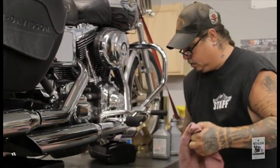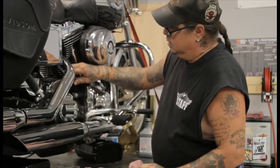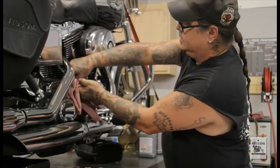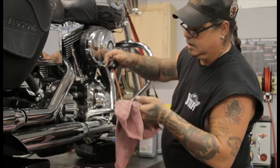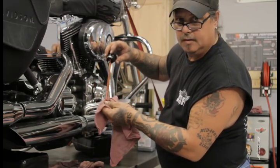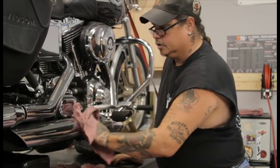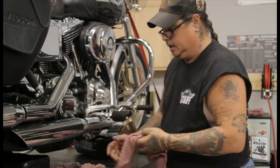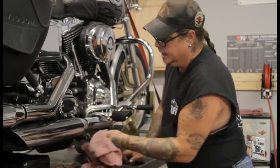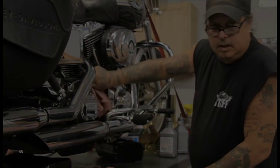Add your last half quart, wipe the dipstick off, reinstall, and let it set for a few seconds. Recheck your stick — it should be to the full on the hot mark, and this bike was already warm when we started. Once you're up to level and confirmed, reinstall your dipstick. At this point wipe and clean all your surfaces, especially the exhaust, because once oil gets on there and the exhaust is hot, it will be on there for the life of the motorcycle. Take a clean rag, wipe everything off real good, and you've successfully changed your oil.